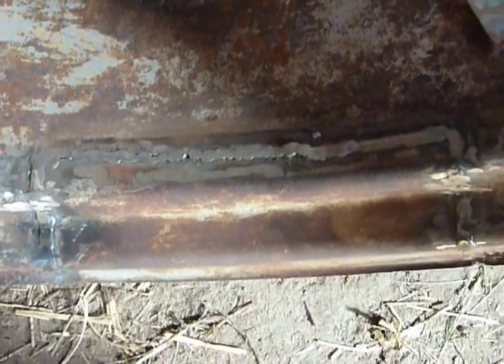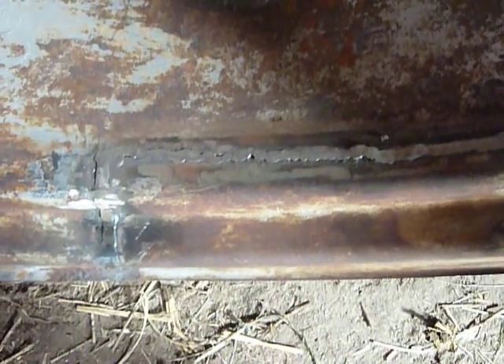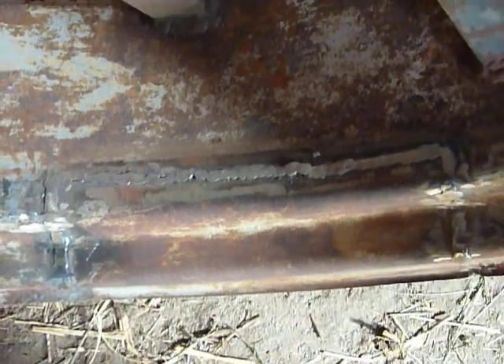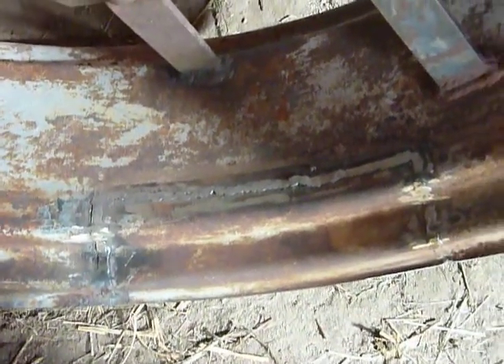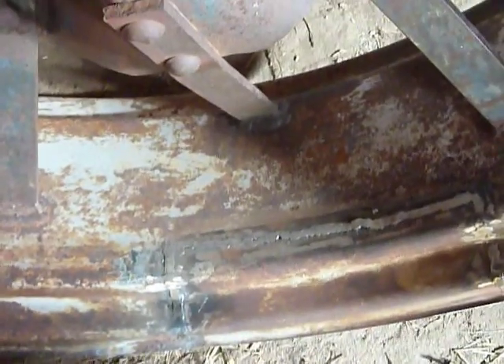I'll have to do a little bit more feather grinding and blending there. I want to get it down to where I can add just a very minimal amount of body filler and then be able to prime over that. It shouldn't take too long, probably a half hour to 45 minutes. I hope to have it done in the next few days, and then I can go ahead and use the wire wheel on the rest of the rim inside and out. Then I'll be ready to mount some rubber on them.